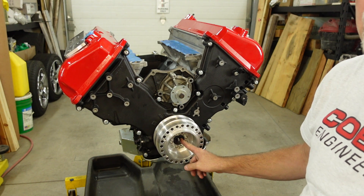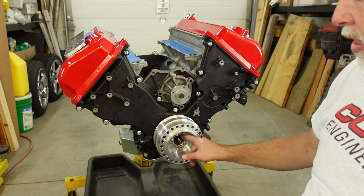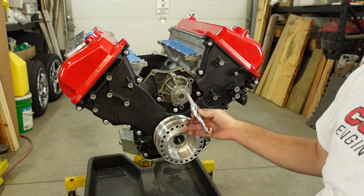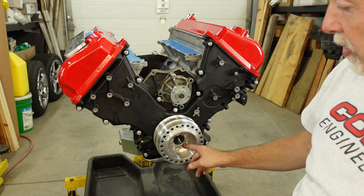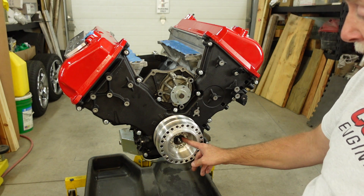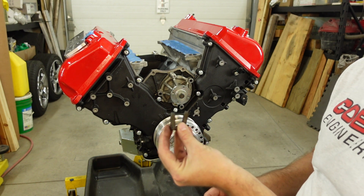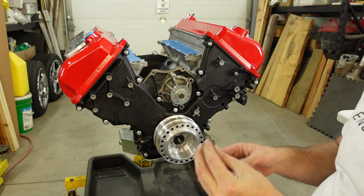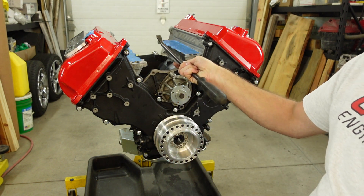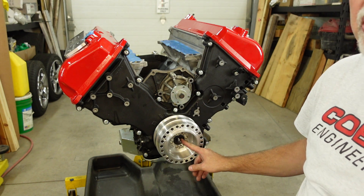I use thread sealant on the stud, and the stud is tightened by hand — not torqued into the crank. RTV on the back of the washer and the back of the nut to the washer. We don't want any oil seeping out of there and thinking we've got serious issues when it's just that we forgot to put the RTV or silicone on there. I run that nut down and then I used two old bolts on the back of the crank from a flywheel or whatever you've got, and a nice pry bar. I wedged between those two nuts and the standoffs on the back of my engine stand and got 160 foot-pounds of torque on that.